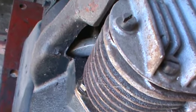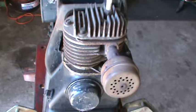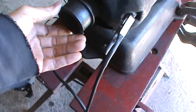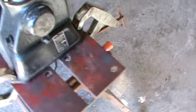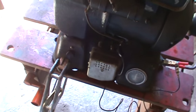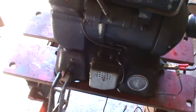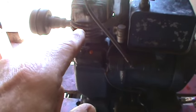You can see the flywheel back in there. This can either be rope started using the cup here — it's got a little groove for you to put your rope in, yank it around and rope start — or most times your motor is not going to start on your big tractor because your battery is down, but it's not down so much that this won't start it because it has such a tiny motor.